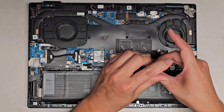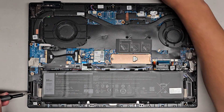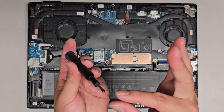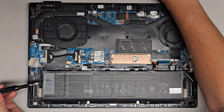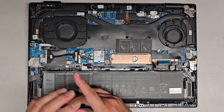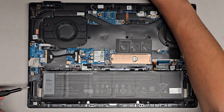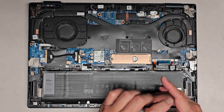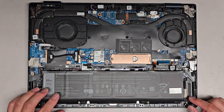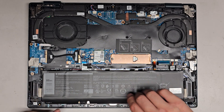We've got one screw there and one here. They actually label this M2 by 4 — I believe that measurement is a 2 millimeter diameter and 4 millimeter long. And then these have 2 by 3, so these should be a little bit shorter. It looks to be about the same to be honest, so I'm confused. But it's always a good idea not to mix up screws. This says 2 by 3 even though there's nothing there, so I guess maybe this is a battery that's more universal.